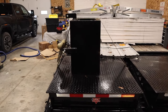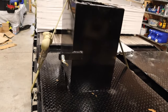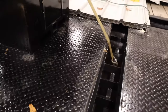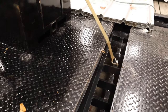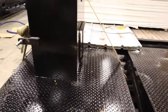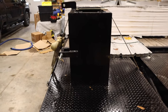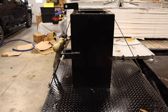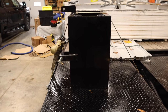This is a ballast box I have on the back of the trailer. I opted to put it back here because I like the angle of the strap. I have the space between the two ramps to use. There's a beam down there — one of the trailer supports — and it allows me to put these straps at a much steeper angle as opposed to going all the way over the trailer. It really keeps this ballast box from moving around, especially when it's in the back or on a load where I can't see it. That's important.